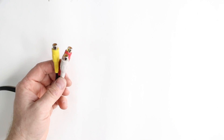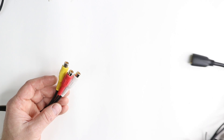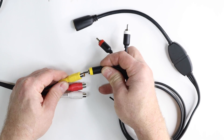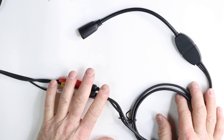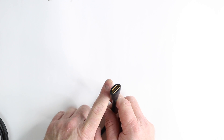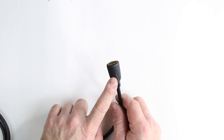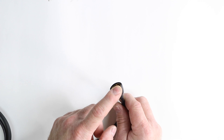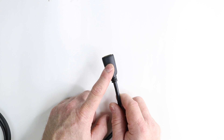Now that we have the CA-C3AV plugged into the back of the radio, we have our video input. We want to plug in our iSimple MediaLinks cable and just match up the colors — yellow to yellow, red to red, white to white. What we want is this right here — this is the HDMI end. If you've got an Android phone, you'll plug your Miracast dongle directly into this. If you have an iPhone, you need an HDMI cable so you can plug in your lightning adapter.